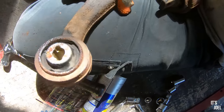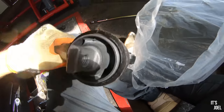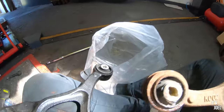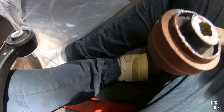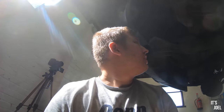You can see the bush has completely perished. If we grab the new lower control arm for this side, the bush is complete - there's no cracking or tearing. Comparing the old one: it's a little bit cracked on this one, and this one is pretty torn and missing a lot of the actual bush itself. So that's what was the MOT failure. The tricky bit is going to be getting it all back on - but I'm chuffed that I managed to do it.